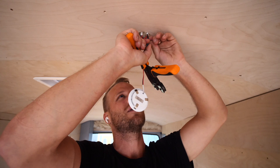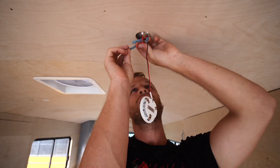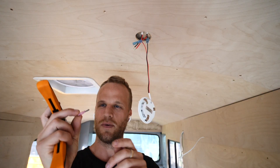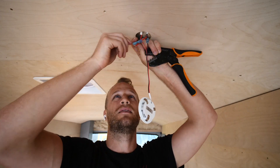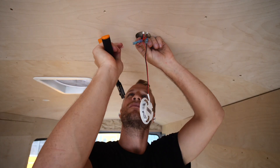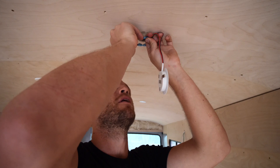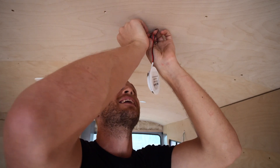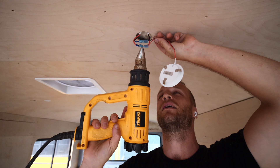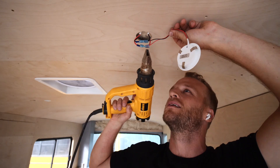You need a little bit of strength to squeeze that with one hand. Now we've got the spade connectors for the other side - crimp that on. Something's up with these crimpers - they're just not getting it tight enough, so I switched to automotive ones because my crimper makes them way tighter. Once you have everything crimped, take a heat gun and heat up the plastic sheathing - the stuff's going to melt down and also become waterproof.